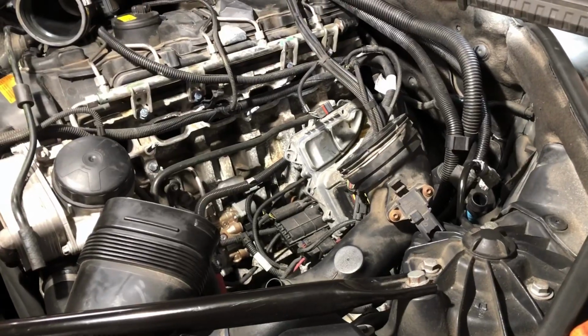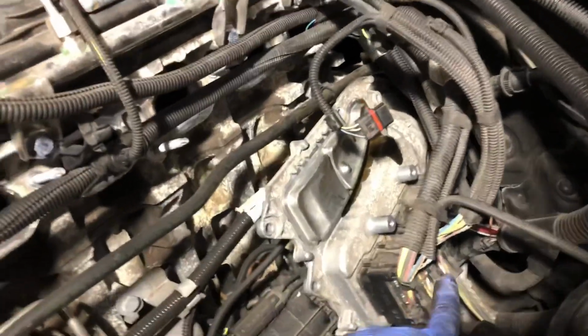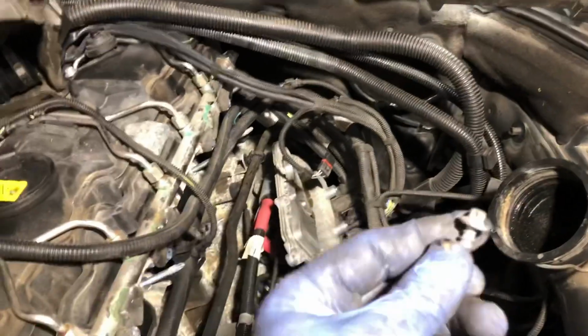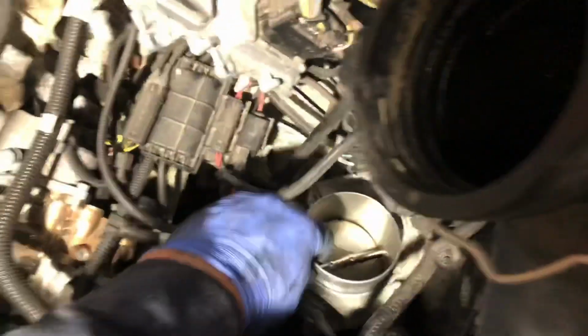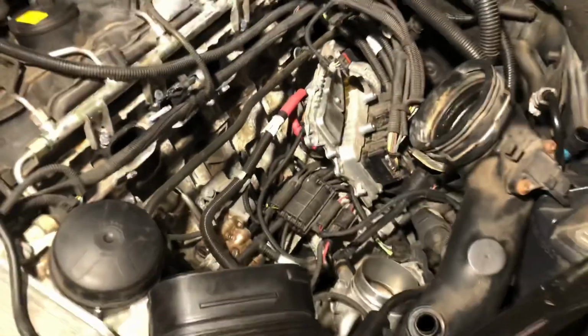So as you see, I got the manifold out, but this manifold actually was attached to this right here, and this got all the wires on it. I couldn't get it out, with the wires where the manifold was. You got 4 of these screws that are holding it, and then 2 small ones. It was holding on this manifold right here, as you see. Now what I'm trying to do is disconnect the wires from this, and the starter is right there finally. And I got this unclamped from here, and this was 4 screws as I showed you in the second part. So I'll see you in the third part.